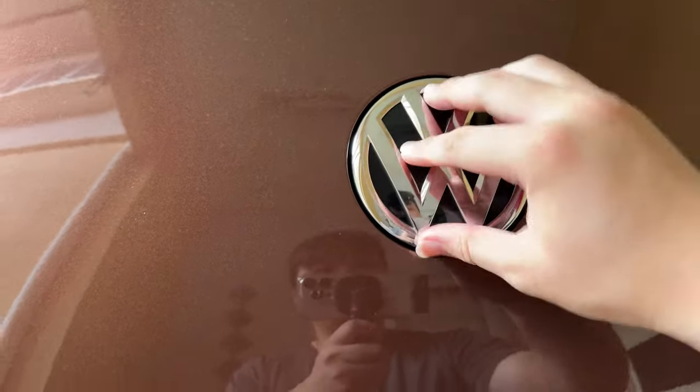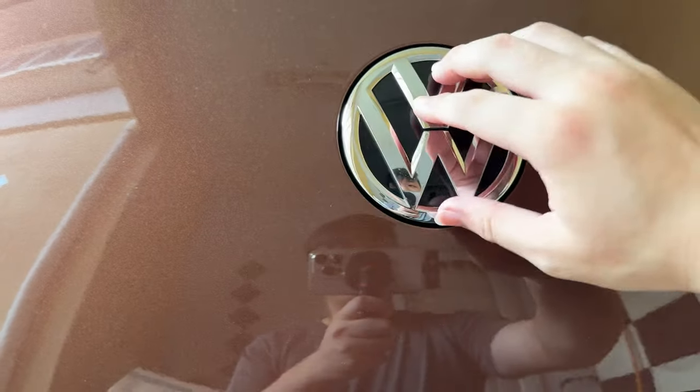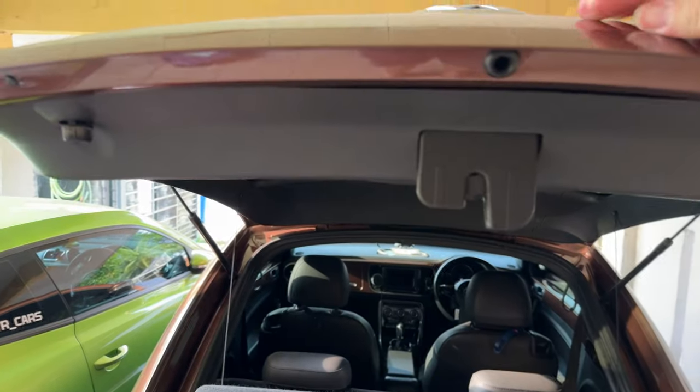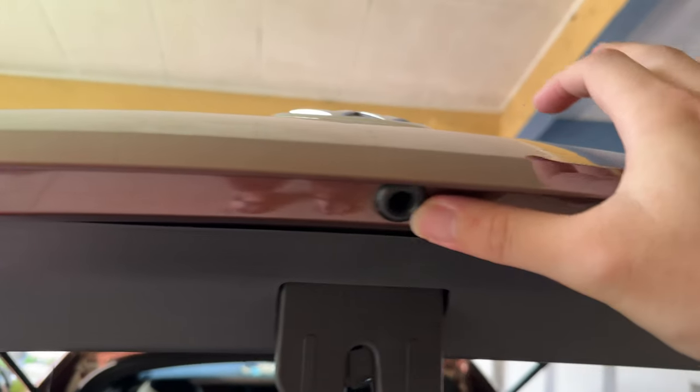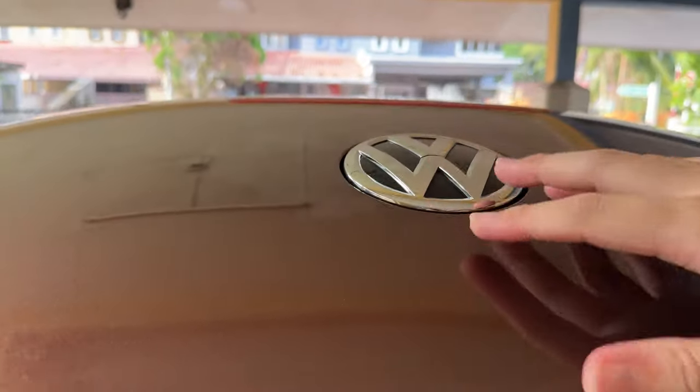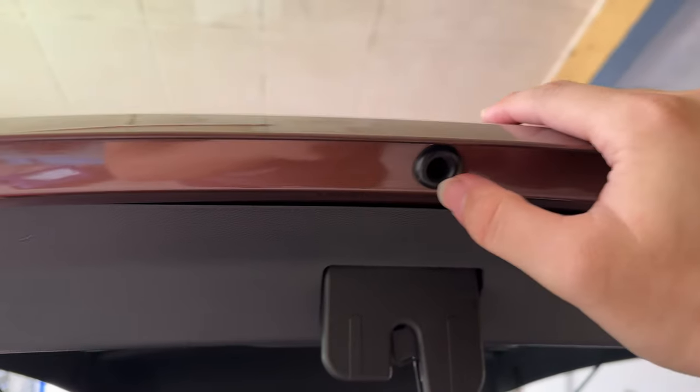So you already know that this Volkswagen logo actually tilts to open the boot just like this. So with moving parts like this, definitely the water has to drain out somewhere. The reason why water is actually collecting in the boot is because of either debris — usually leaves and stuff like that getting stuck — or the drainage pipe is basically out of position. When you open this, it'll be the same with all the Beetles. You can see right here, that is the drainage hole. So the water actually goes into the lid and then it drains out through this hole. It's actually a small, very short tube.